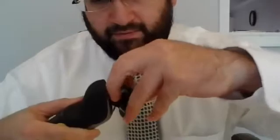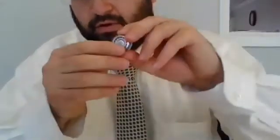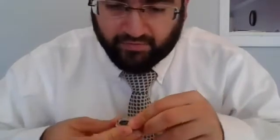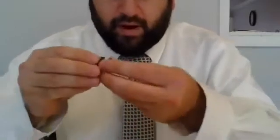Looks like that. You've got a little release latch up here, I believe. And you can pull the top off. And you have your little shaver heads in there. We're going to unhook one of them and pull it out. We pulled it out. Here's your little screen. Just make sure you remember how it goes in there so that when you want to put it back together, you don't forget. And then you just untwist this little blue thing. Let's see, which way do we want to twist it? Twisty twist. Oh, actually, it fell right off into my hand. And then you'll pop out the blade itself.